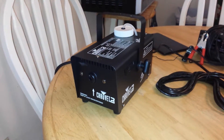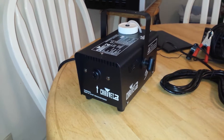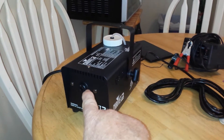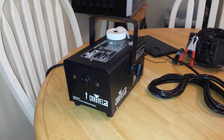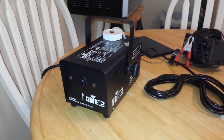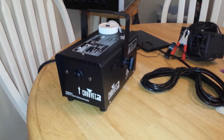This is my new smoke machine that I paid $32 for on eBay. I'm going to put some kind of a hose adapter right on there and run a hose to the vacuum system of my car, because I have a leak in the vacuum line system and the best way to find it is with a smoke test.